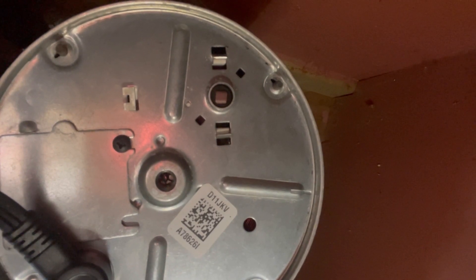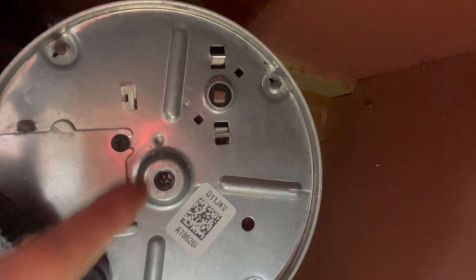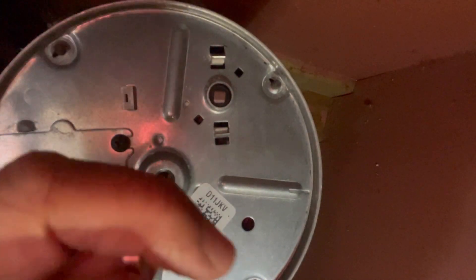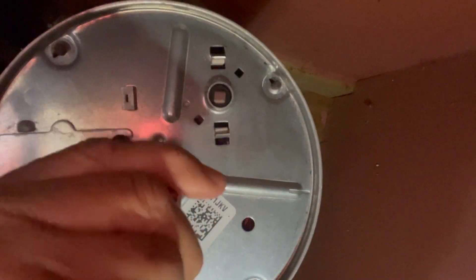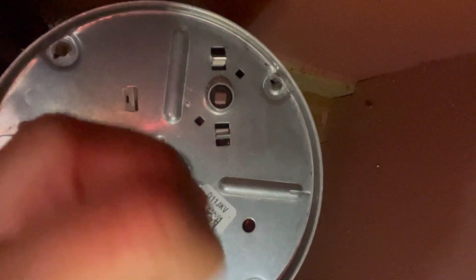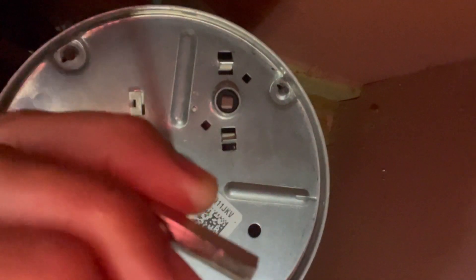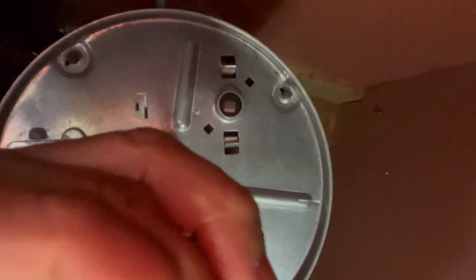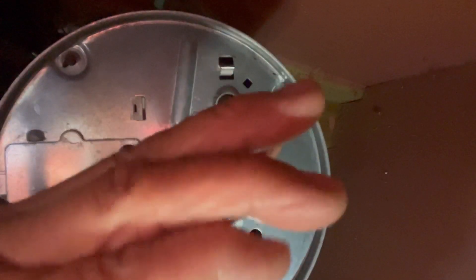Keep turning it forward and backward until you get the machine spinning. Most people immediately say to replace the machine, but most of the time the only problem is that rocks or debris have accumulated and calcified over time — hardened residue from dishwashing that has solidified inside the machine. What you need to do is get an Allen wrench, keep turning it, and make sure it fits properly.